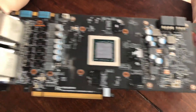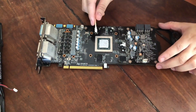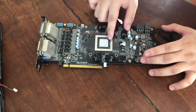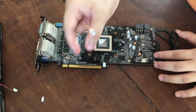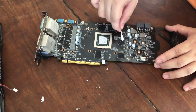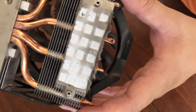There is some dust buildup on the PCB. To remove the thermal paste, spray some alcohol on the tissue and gently wipe it off. Use some cotton swabs for the sides. Also remove the thermal pads on the VRAM. For the heat sink, you can also use an old toothbrush to remove the dust in between the heat sinks.